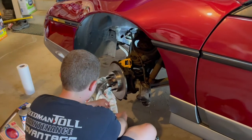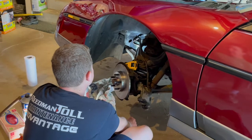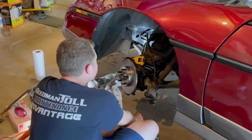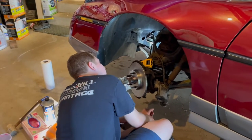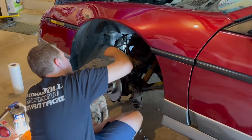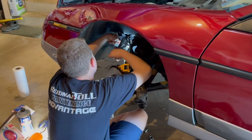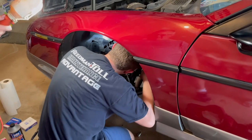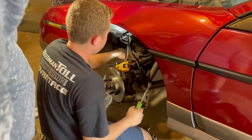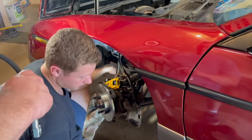Well, Eric, we have two options. We can continue to try and get this brake line off, or we can replace just the caliper and see if that works. Well, I don't want to go and ruin another rotor. Continue then? Yeah, I'd say. I don't want to do it wrong and then have to buy all the parts again. Because it's crimped onto the hose itself. I see. No dice. Okay. Well, then our only alternative is to drill that out and tap a screw for this one.